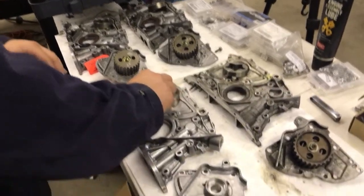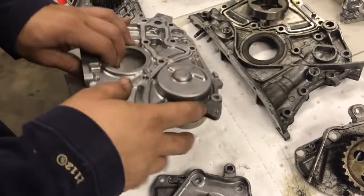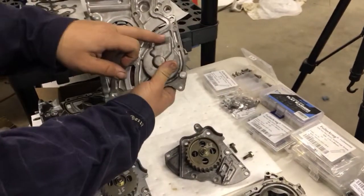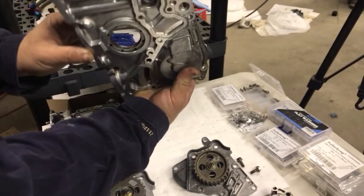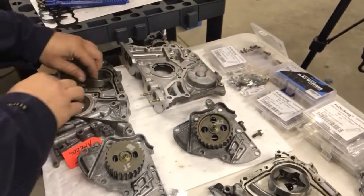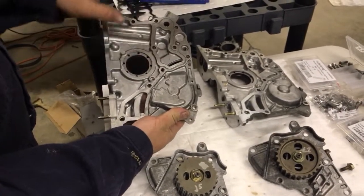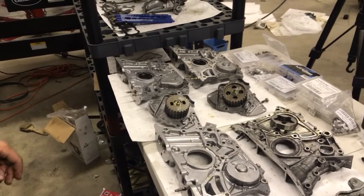There are a few differences in the actual cases I want to show you — located on the back of the pumps. There's a small oil gallery where the rotor sits. On the Caldina pump, there's actually an extra passage, and it also has what appears to be oil drain properties, possibly for the seal. The Alteza one is different as well — it has extra flow passages and also holes in the bottom, which is very interesting. I'm not sure exactly what those are for.